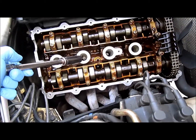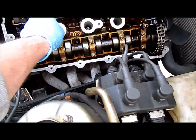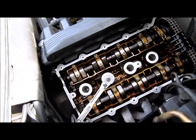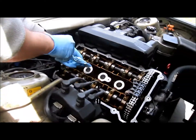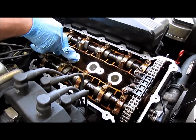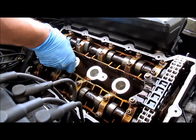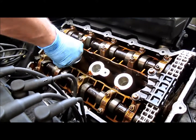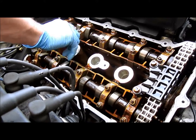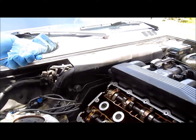Otherwise you can't clean the oil out of the spark plug well there. I'm going to use a 5/8" deep well socket — I think that should fit over. I'm going to loosen up the spark plug and then I'll use a magnetic extension to pull it out. To clean the well, I'm going to put a paper towel in there attached to a pair of forceps. I'm going to try to soak up the oil — it will take a couple of applications — and dry it out as best I can.